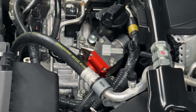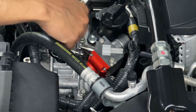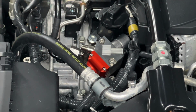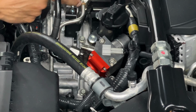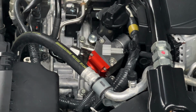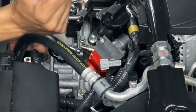All right, so now at this point, you're gonna see that the outlet does not line up with the fuel line. So we have to bend this line into position. You gotta be very careful not to bend it where it's gonna strain the welds over here, because this is where normally people crack it. So you kind of have to hold here and bend this portion up.